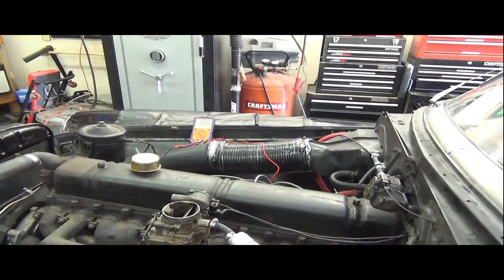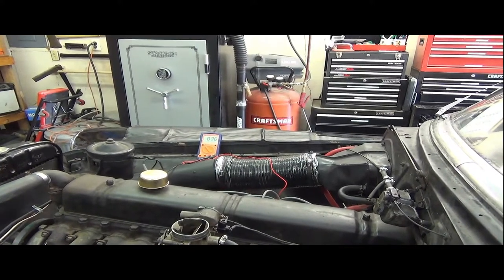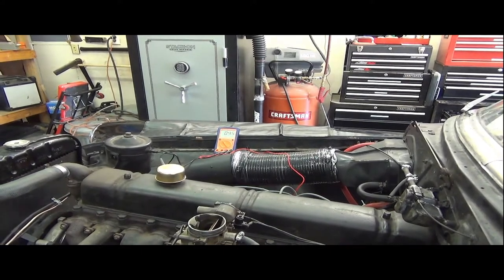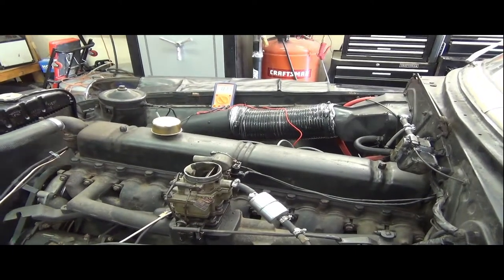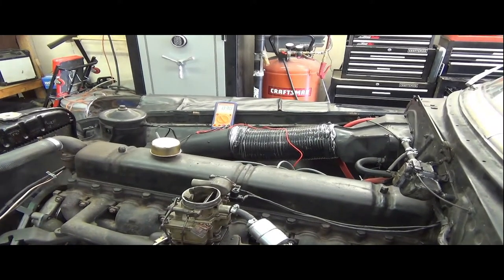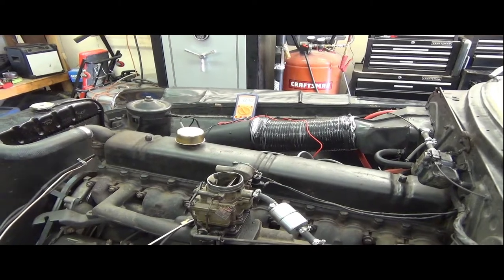When you just kind of shook it out, it drops down to the 380, 400 there. So there's a little bit of slop and play in the throttle linkage there. So that's not even a true throttle stop carburetor setting. So there we are, 320. Anyway, I might actually tighten up that throttle stop screw a little bit there.